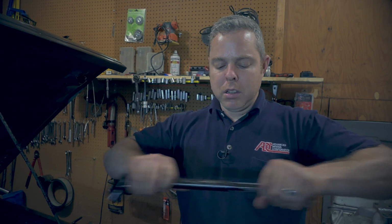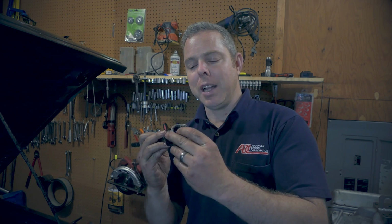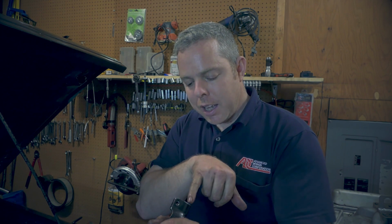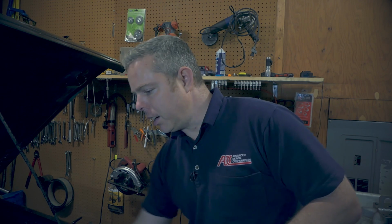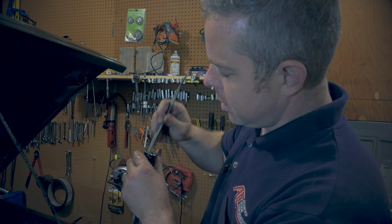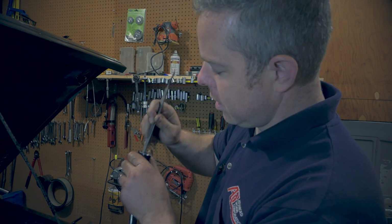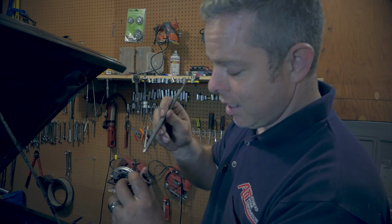All right. So once you get in there, it goes nice and smooth. And the reason why I did that was because when I was sliding this onto the shaft where these splines are, it would go in a little bit, nice and smooth, and then it would just kind of stop. So when I looked in there, this did come out of a wrecked car and a couple of these spots were slightly boogered. So all I did is take a file, where's my file at? And I went up in here in these splines, just making sure they're nice and smooth all the way down. Each one nice and straight. So I guess you can say I'm kind of retapping these splines, if that's a thing, who knows.